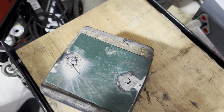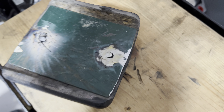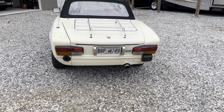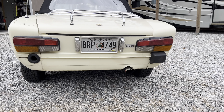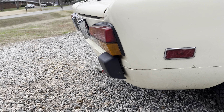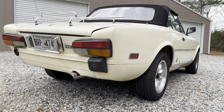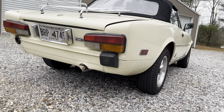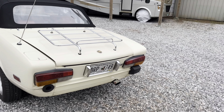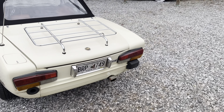Right now we're just adding a little bit of weld onto each side to get the bolts off, then we'll grind down the weld. Made a little bit of a gap so I can fill the end right around the bolt, and then we're going to weld the pipes to it. There's one tacked up — it fits nice and flush on this side. The other side has a bit of a gap because of how it's mounted, but it's really not terrible and not noticeable to anyone other than car guys. It sticks out farther than the taillight does, so it might save your taillight.